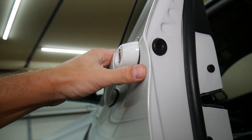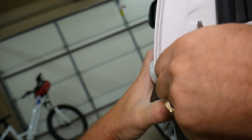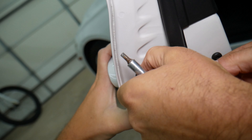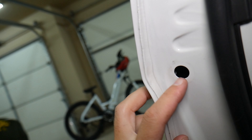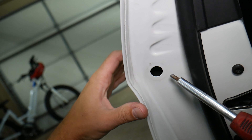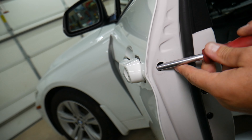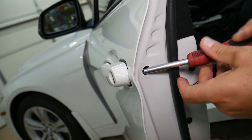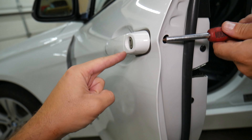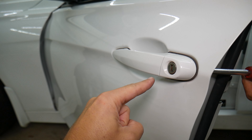We're missing one thing — let's see if this door has been removed before, because one soft bushing is missing. We'll need to buy a replacement. Starting here we have one, two, three, four, five, six, seven, eight, nine — nine clips total to remove that door panel. We'll demonstrate on this 3 series, but the 4 series will be exactly the same.